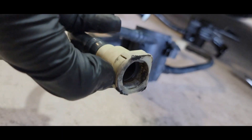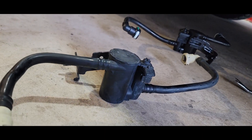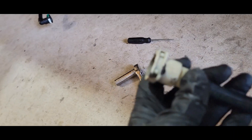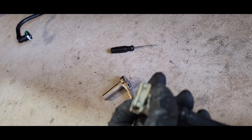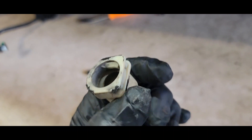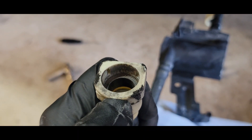On the connectors, you see this little piece right here that just pushes in — I don't know if you can see inside there. You push that in and that unlocks the little locking mechanism on that hose. You can see the little tabs right here — that's where it locks in place. When I push on that piece in the back, you can see how they open up. That's the ring right inside, that's your lock. Boom — push that just like that and then pull it off.